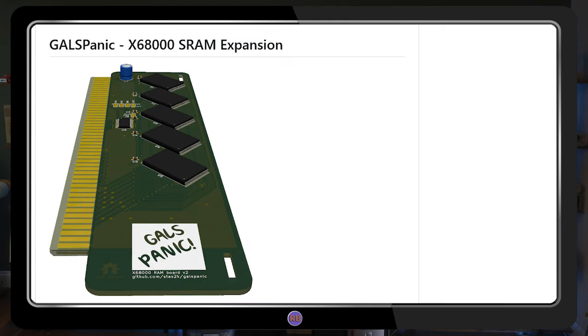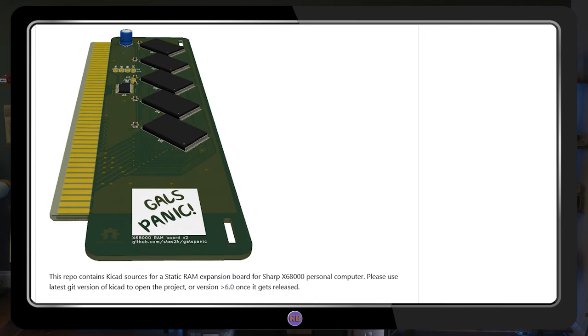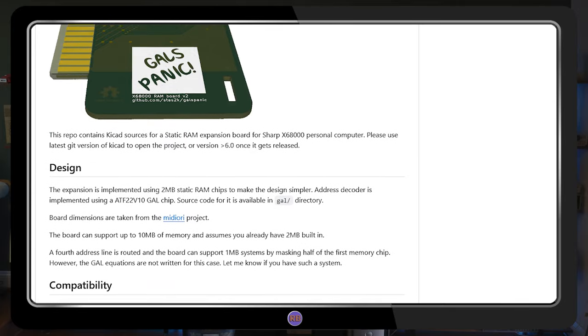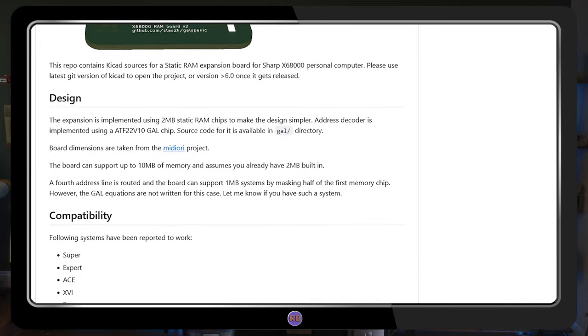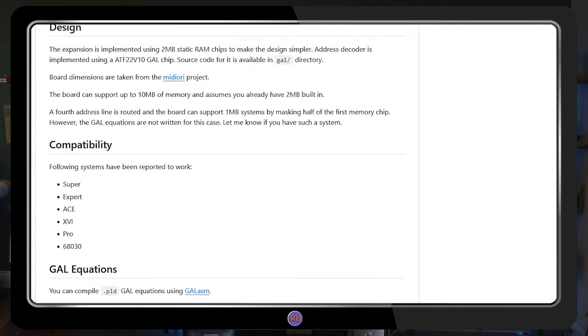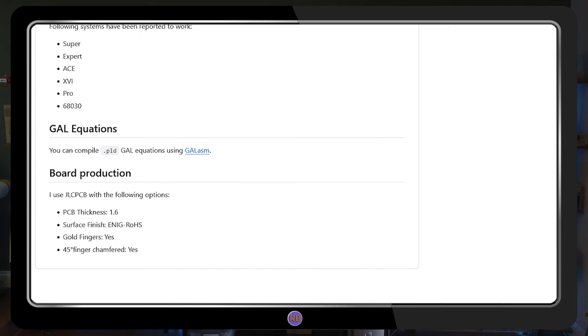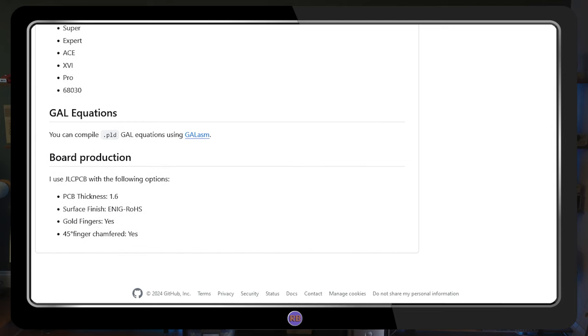Anyway, why the extra RAM? A good number of games required more than the base 2 MB my system came with in order to be run from the hard disk. The reason is that floppy drive emulation has been used to trick the software that was never designed to run from a hard drive in the first place. The drawback? This needs additional memory beyond the game's original requirements.